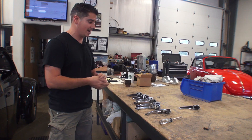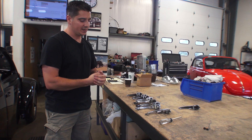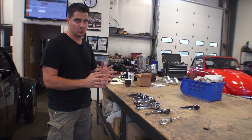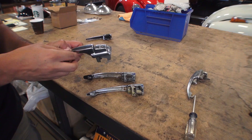The unfortunate problem we face today with door handles is, of course, aftermarket. I have a couple of aftermarket handles here and I want to show you the differences between the aftermarket and the originals. The problem we're having with some of these aftermarket handles is that the buttons aren't functioning right — when you press the button in, it's not giving the mechanism inside the door enough push to unlatch from the striker plate on the door post.